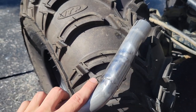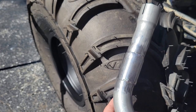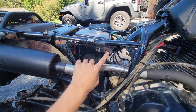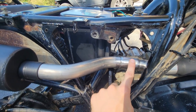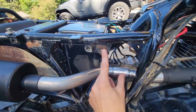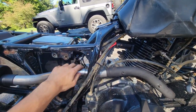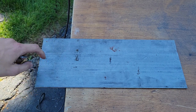Here's the final product, all cleaned up — looks pretty good. But you can see right in this area I started running into porosity, so I had to tuck in the garage to get out of the wind as much as possible. The original muffler started here, bolted in here, came back, curved around, and bolted in here. I want to build a support bracket that comes off of this bracket. I'm going to weld it onto this piece — it's actually the thinnest piece, the weakest, but it looks like the thickest. The bracket will weld on here and bolt in here, giving the middle of this exhaust more rigidity. Right now it's just held by this bolt and the head. I dug around the scrap bin and found some thin sheet metal to cut a strip and start making that bracket.